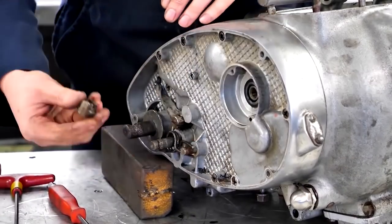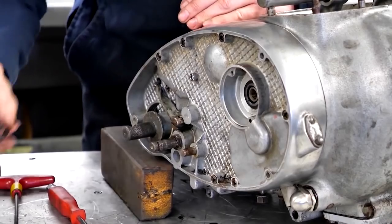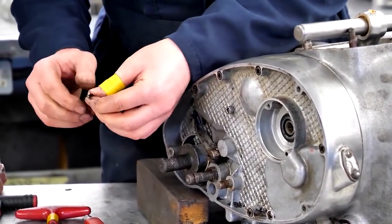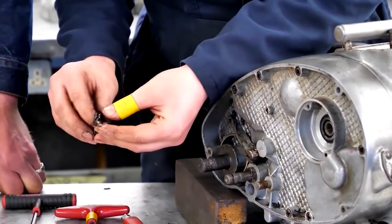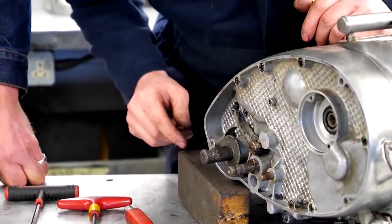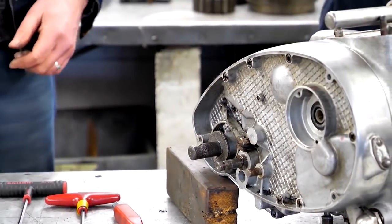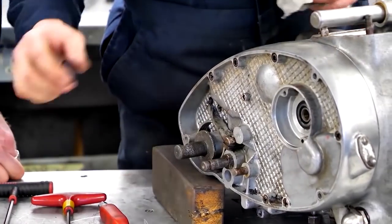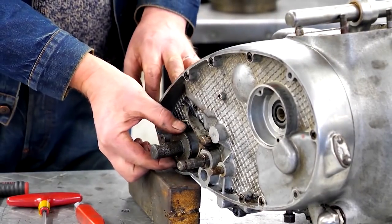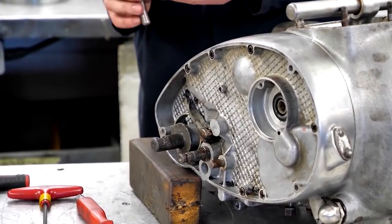So that's obviously the gear pedal return spring — the one that moves your gear pedal up and down, returns it when you change gear. Quite often what you find is that the spring isn't put on properly — it's not been crossed over. If they just put them on without crossing, it doesn't quite work as well. You cross them over so they work against each other. There's a washer on here that presses onto the shaft; it's got flats on the side to keep it in place and the spring hooks over it, but when you come off you've got the full tension of the spring and it can get a bit vicious. We do have a little tool here that goes over and then you can twist the washer and tap it on — saves your fingers.